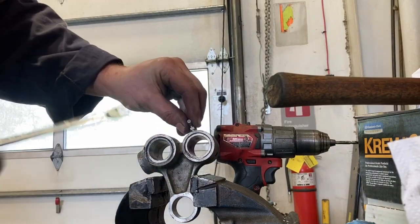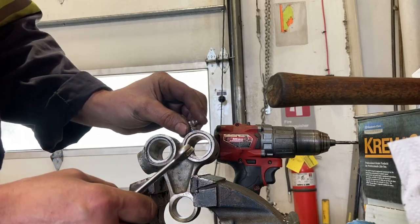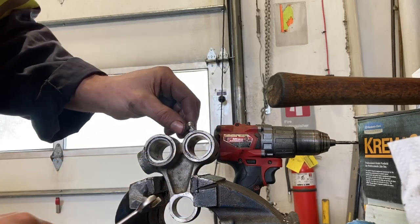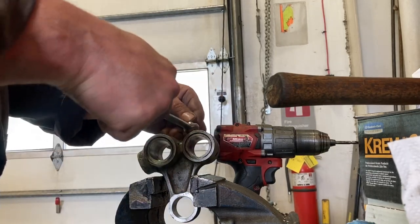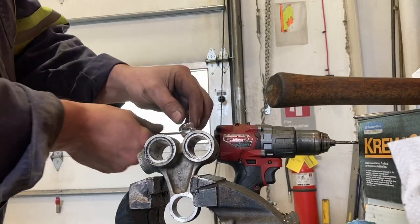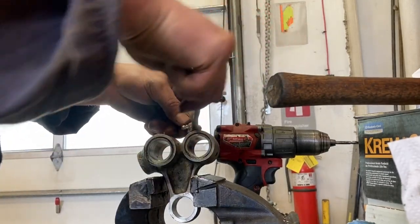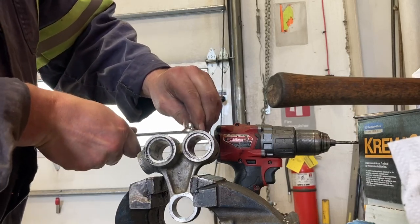It's things like this — you just have to make sure you get the right tap. This ended up being a quarter-inch bolt for the 90 that I've got here. But things like this: you spend a little extra time when you're doing your maintenance to make things greasable, and it's going to save you a lot of money and time in the near future because you're going to be doing your bearings a lot less now that you're able to grease them.